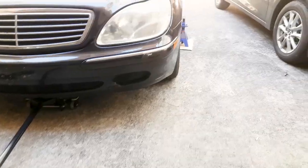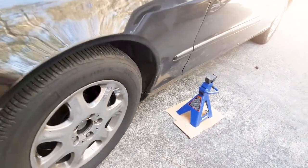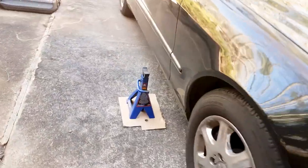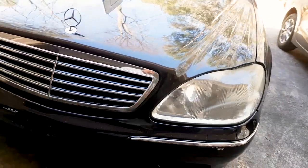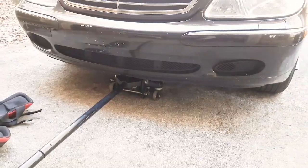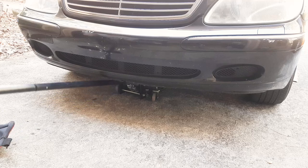Now, why you would want to replace the wheel hubs, bearings, and races. There are two races inside a wheel hub, an inner race and an outer race, and two corresponding bearings, inner bearing and outer bearing, and then a seal ring. The seal ring is what the wheel speed sensor reads to measure the rotational speed of each wheel.